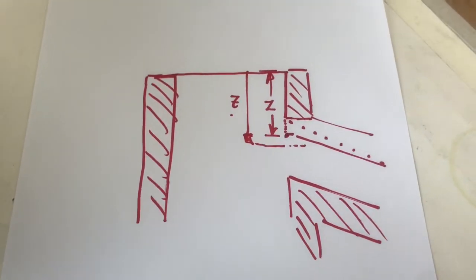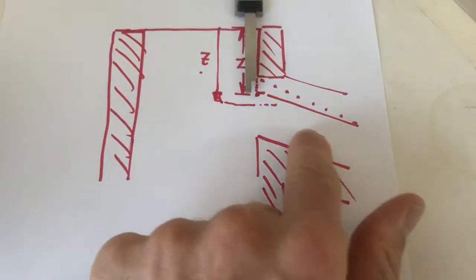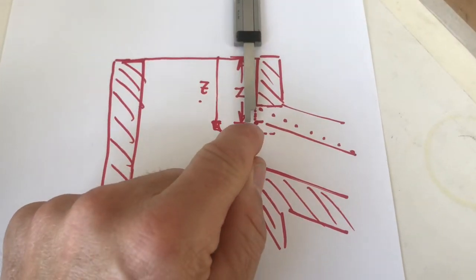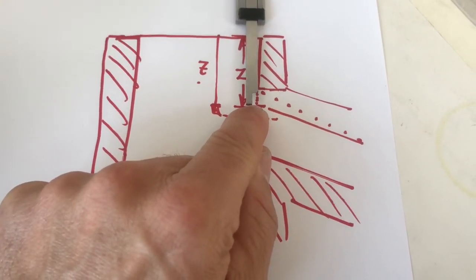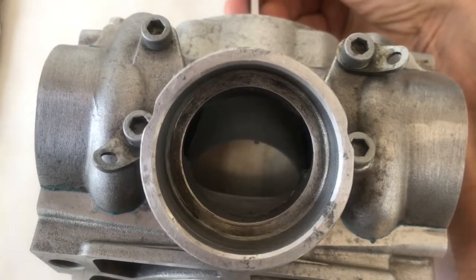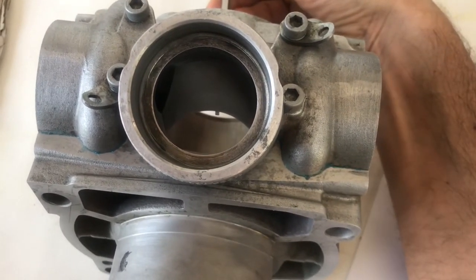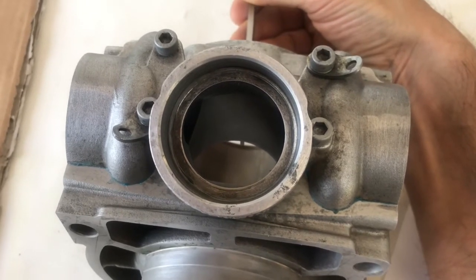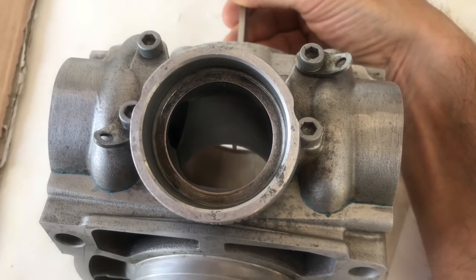Because of that angle, when you look up the exhaust port, you're going to see the end of the caliper sticking out. It's going to look like the distance is longer than your actual current setting. But what you're actually looking at is where it breaks from the power valve to the bottom of your caliper — how smooth that joint is. Looking up the exhaust port, you can see there's a bit there. That's set at the correct level, and that's what it looks like. You've got to check how the top of the valve blends into the caliper.